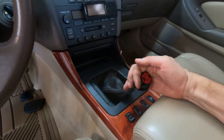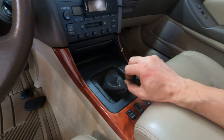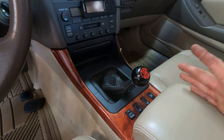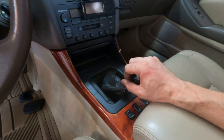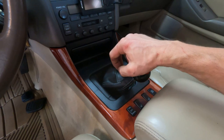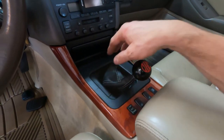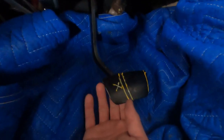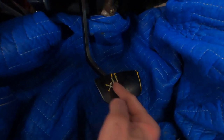Fourth gear is pretty close down here - it's pretty close to your lid. There is a way you can get a straight shaft or straight lever which will bring fourth gear up a little bit and make it more centered. It's time to get the pedal cut. I'm going to err on the side of caution and go for the outer line because there's a weld behind this - you really don't want to cut the weld and have the whole pedal fall off, so pay attention to what is behind what you're cutting.